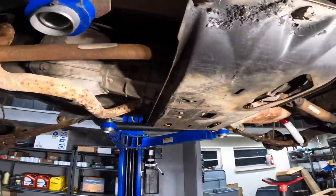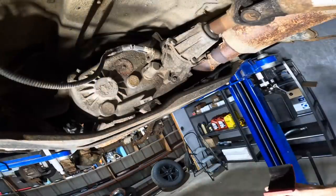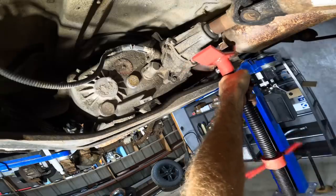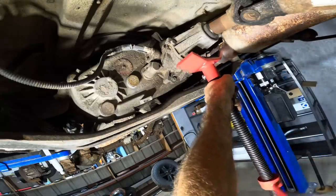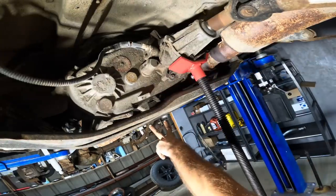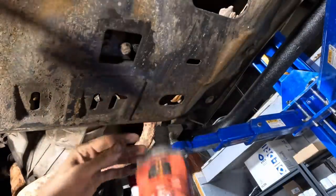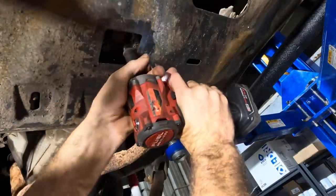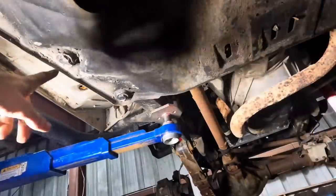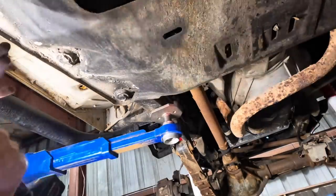Don't have a lot of time tonight. I'm kind of squeezing this truck in between other activities. First things first is this ginormous plate needs to go away, but this plate is part of the transmission mount. So we're going to support the tail shaft of this transfer case with this high-reach jack stand and then go in and disconnect the mounts and lower this thing down. We'll disconnect the transmission mount right here and then remove the bolts that secure the skid plate to the frame rails. Jumping right into it at the trans mount — there are two 15-millimeter nuts. Along the edge of the plate, there are six more bolts. Those are 19s and they thread straight into the frame.